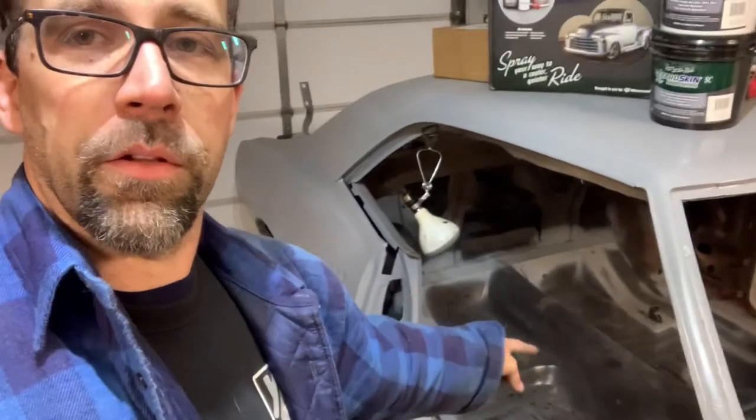We're going to do the ceramic coating and sound deadener. We're going to put two coats here on the floor. There's a 24-hour wait time in between them. I'll show you how to do the first coating, then basically wait 24 hours and repeat the process. You do the sound coating first, and then the ceramic heat shield afterwards. That's the procedure per the instructions provided by Lizard Skin.